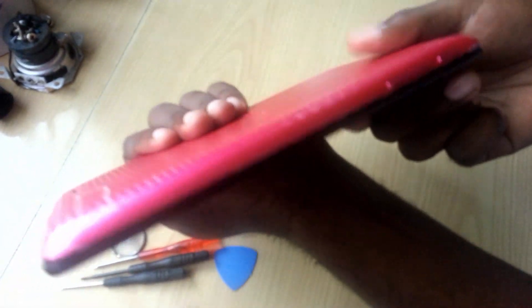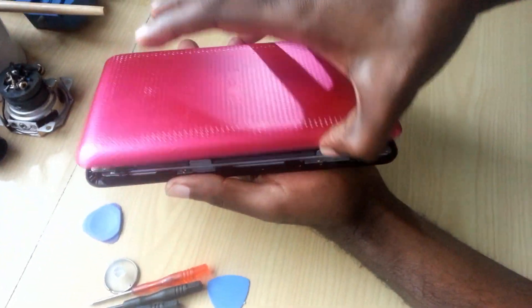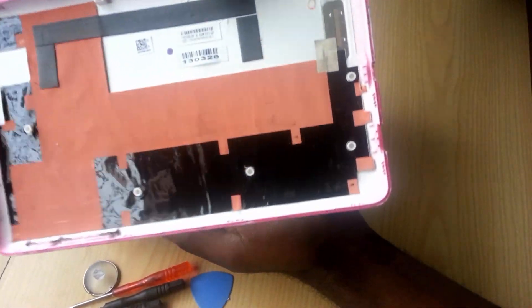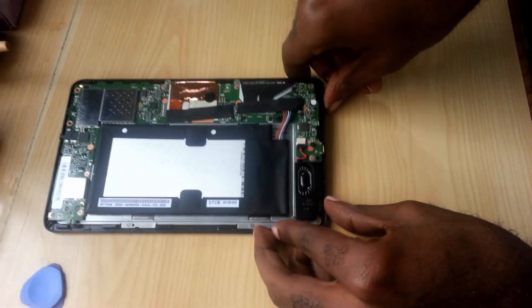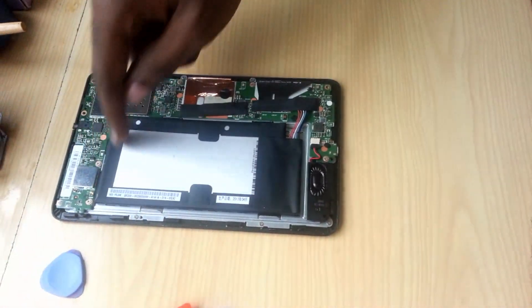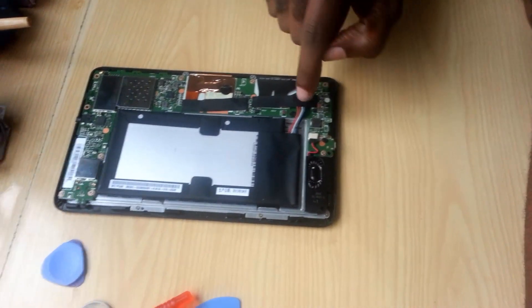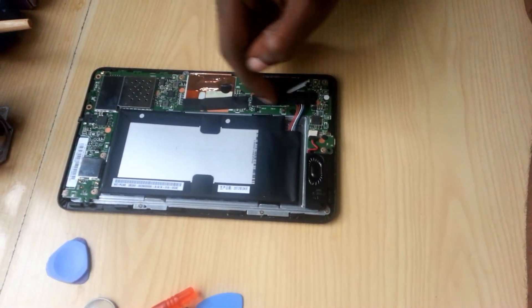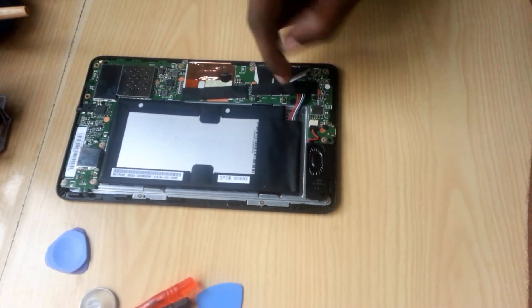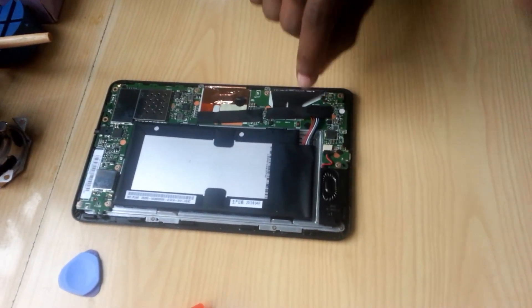I've pre-opened this using this tool or any other blunt object you can find. Once you have opened it, this would be the back cover. On the inside, you'll notice this is the battery, and you have the circuit board. The issue is caused by the battery. You'll notice there's a connection port where the battery connects to the board, and there's a safety strip — you'll have to peel this off. Be careful not to touch any other components on the board as it can damage it.